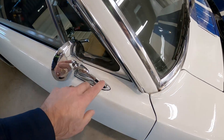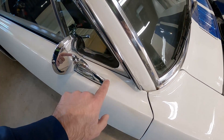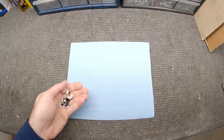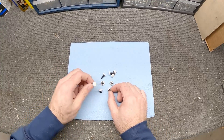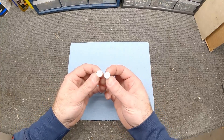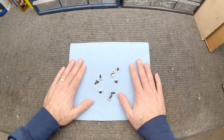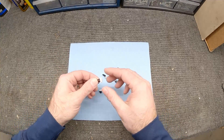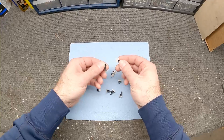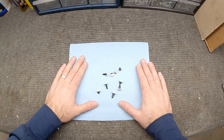The first thing I want to do on the passenger side is take the mirror off and see how big the holes are in the sheet metal, because the old hole locations are going to be there in the door. I've got a solution to temporarily plug them — just a handful of black plastic clips you can buy at any auto parts store that are meant to fill in a hole. I painted them white; it's not the exact color of the car but it's close enough, since I plan on painting the car down the road anyway. So I'll find out which ones fit best and use them to fill those holes in the door.